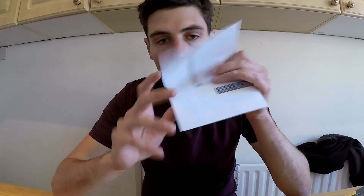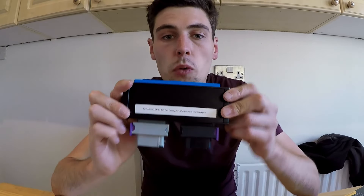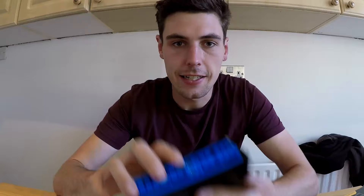The instructions that come with the plug and play adapter are for an EMU Classic. If you are using an EMU Black you will need to reference your pinout card that came with the EMU Black and reference it up to the different inputs and outputs on the adapter. The adapter will also require some configuration in the form of soldering on the board itself inside the CNC case. I will go into that in further detail when I discuss how to build the harness in a later video.